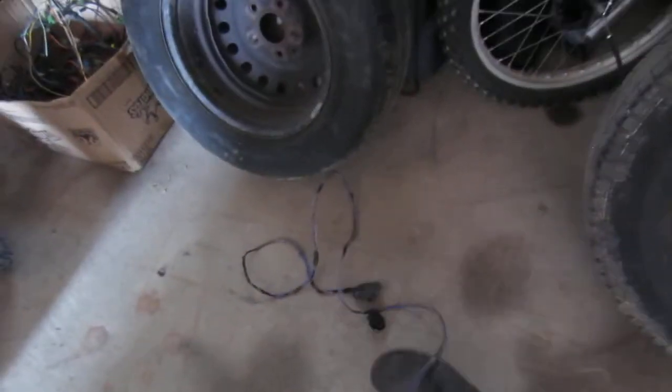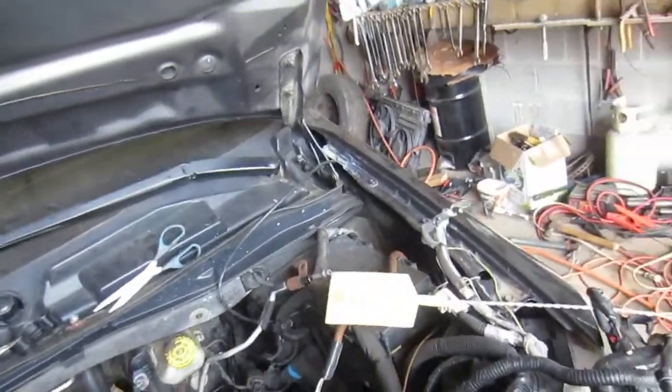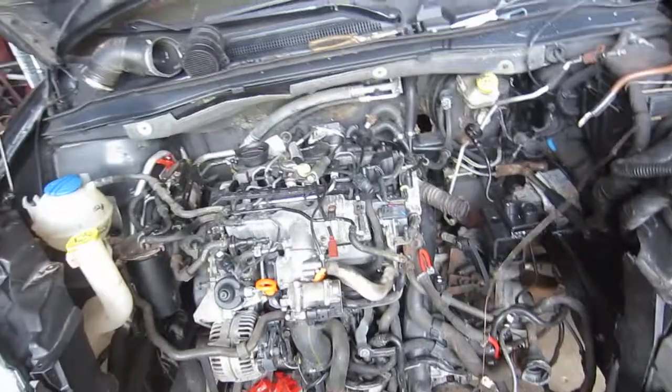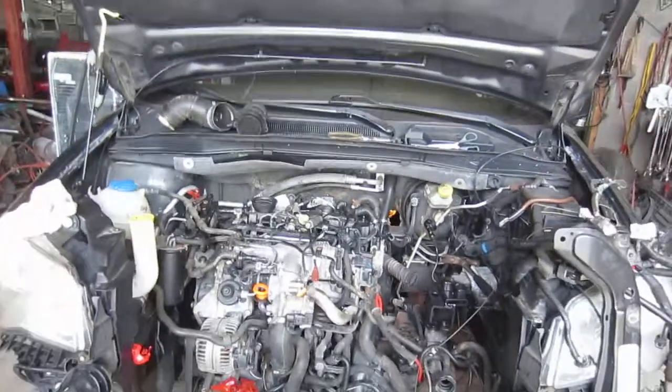That's my ABS wires. And this is my fuel tank wire that used to be connected there. I'm going to use the blue wire on that cable that has a red line — that's going to attach to this brown wire that I added when I cut the circuit out from that big brown connector that's under there. I think within an hour or two I'm going to have this puppy running. Sweet.